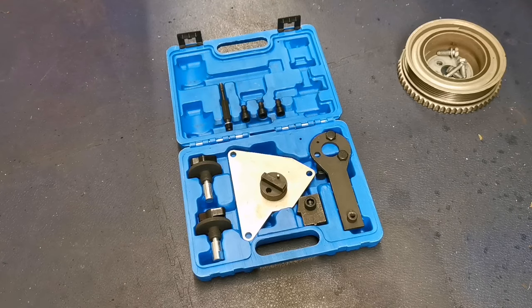The data I have recommends 72,000 miles for a timing belt change on these 1.4s, or 5 years. This car is 10 years old and there's 75,000 miles on it, so that's why we're going to do a timing belt on it. It's just routine maintenance.